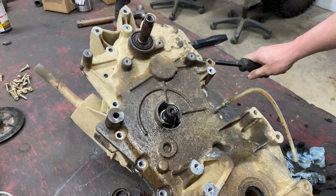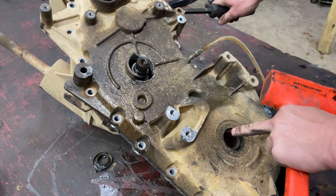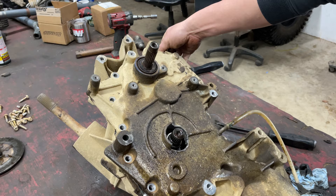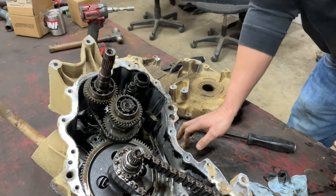This is just one of those things you gotta work with to get it to come off. What you usually run into is once you get the case coming back off, it's going to reach a point where it feels like it's stuck again. What I usually do is on these output shafts — especially where your axles go in and out — if you'll take your mallet you can bump it up here on this output shaft, and that's going to help wiggle that seal loose. Now we've got our half off, and right away we can see this half of our case is busted.